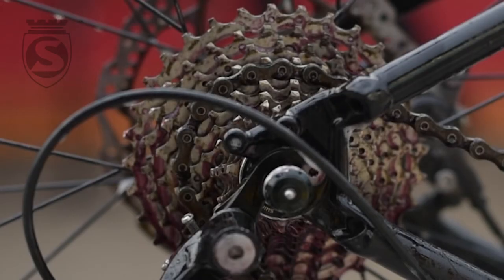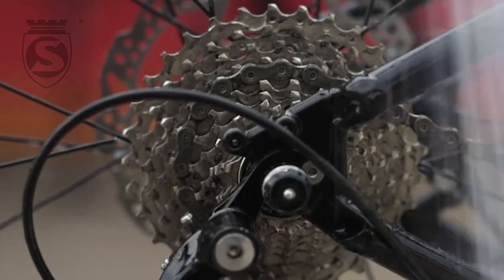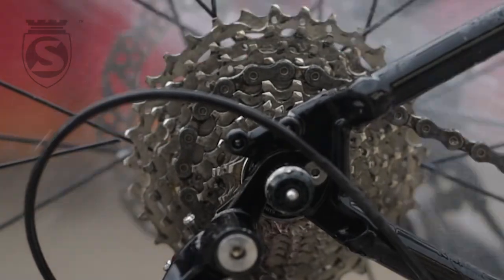In the case of our drivetrain, the stuff we want to leave behind is the wax lubricant that we're using on the chain. It will not climb into the chain and attack oil. If you're using an oil-based or wet lube on your chain, it will not get in there and attack that stuff. It will take the stuff off the outside to clean your drivetrain, but we really don't want this stuff down in your chain, down in your bearings, down behind seals where it's going to be impossible to wash off.